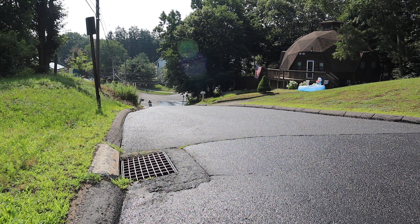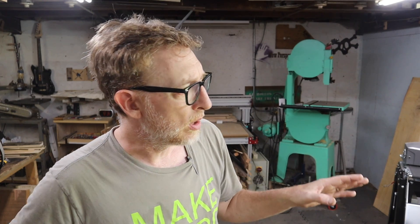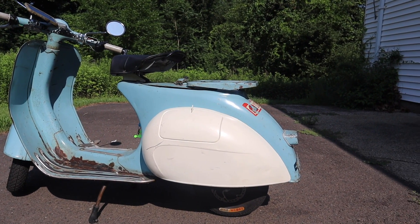The problem I have with this bike is big hills — medium hills are tough, big hills are slow. The reason it's a little doggish compared to other vehicles with even smaller motors is partly because of the weight of the body, where it's not tubular steel, but mainly because of the tire size. A modern e-moped or e-bike is going to have a much larger tire, so fewer RPMs can get that tire moving and get you going faster. In the future, I might get a larger motor and a slightly larger wheel — adding another thousand watts and maybe another two inches to the diameter of the tire — which I think would get me up hills at 25 to 30 miles an hour.